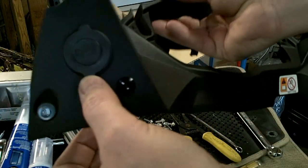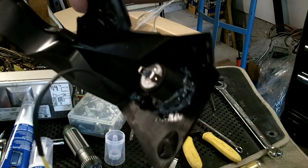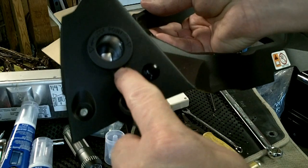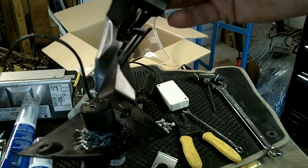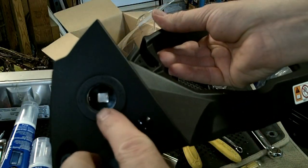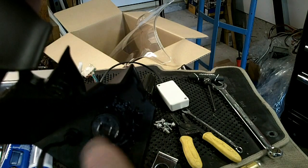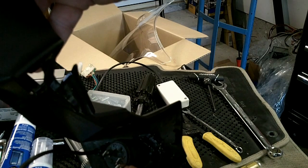The new power point is on, siliconed around the outer edge, and ready to put it back in. I have to let you know that on the inside it is polarized, so the electronics will be looking for that positive and negative pole. The outside is negative, and that little spot way at the bottom there — that's the positive. When you hook it up, you have to make sure that the positive lead goes to the innermost pin and the negative goes to the outer edge.